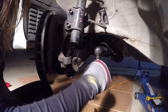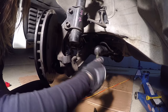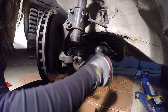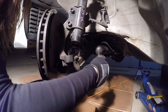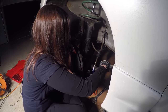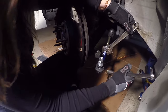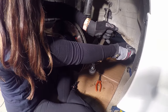Since I'm getting a wheel alignment, I'm not going to worry too much. Usually you try to get it as similar as you can to the old alignment, but this needs a complete front and back wheel alignment because we just changed it to five stud. So get yourself two wrenches or two spanners and just tighten them by putting them opposite ways.